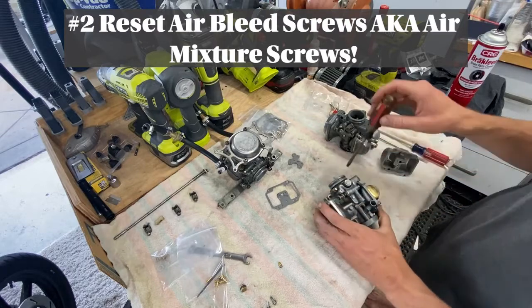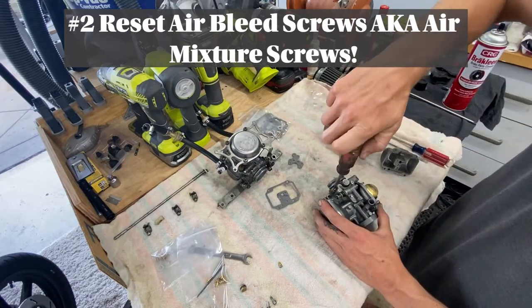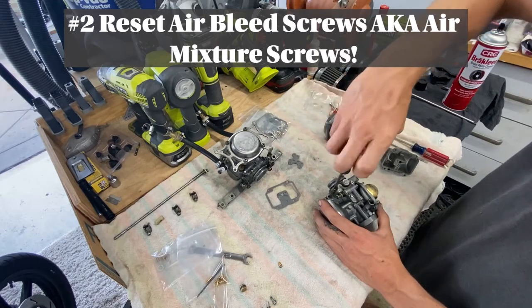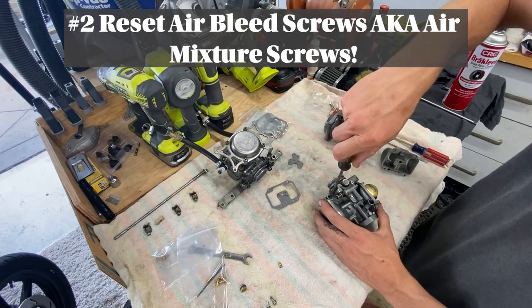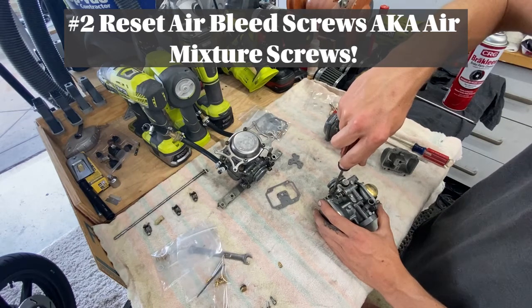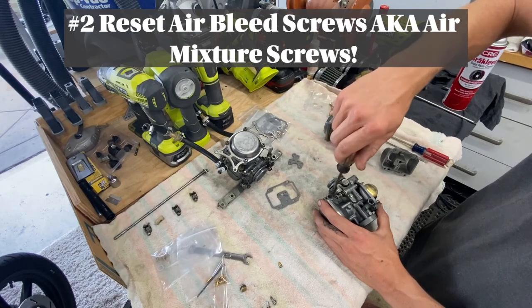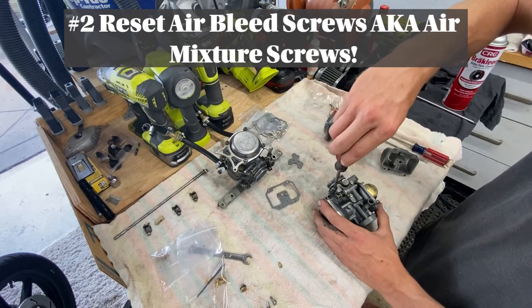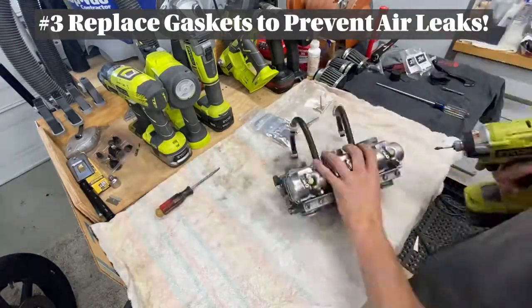Alright, so you tried the pod filter fix and it helped but didn't seem to do everything. The air bleed screw is the next thing you can adjust without taking it all apart, and that's what I'm doing here. For this bike specifically, you can close them completely by tightening them until you feel them stop, and then back them out. For this bike, it was 2.5 turns. If that doesn't seem to help, you're gonna have to start tearing into things.